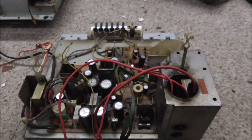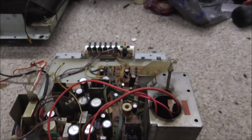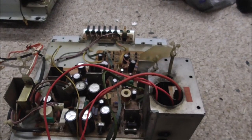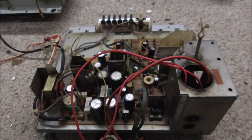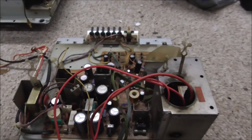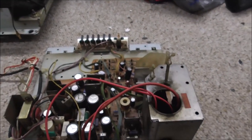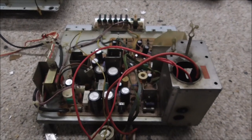Now we've got to bolt it back onto the frame. We replaced all the electrolytic capacitors and replaced the flyback. The only thing we didn't replace was a few of the bigger ones in the power section — you can get them if you order them, but we're just doing it with stuff we have here. We're going to put it back on the frame and then try it back in the cabinet and see what we've got. Hopefully that'll get this one up and running.